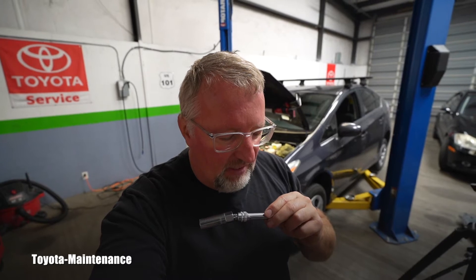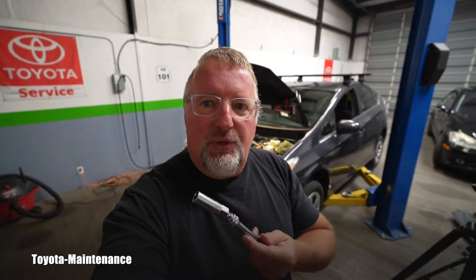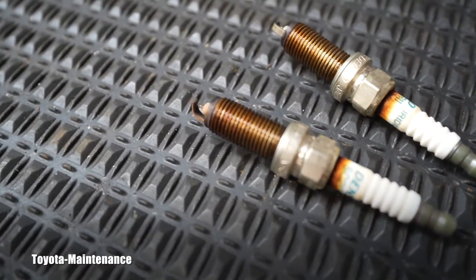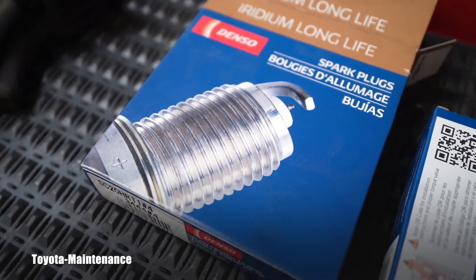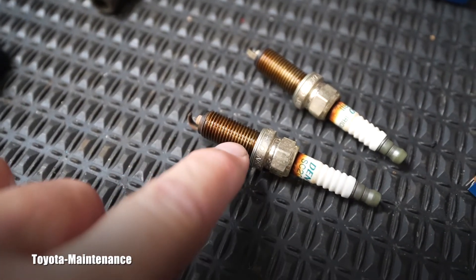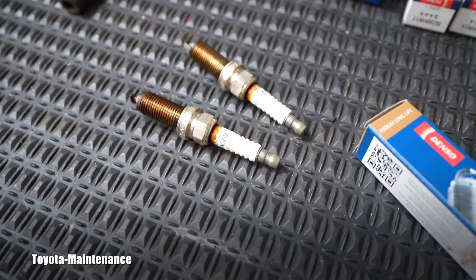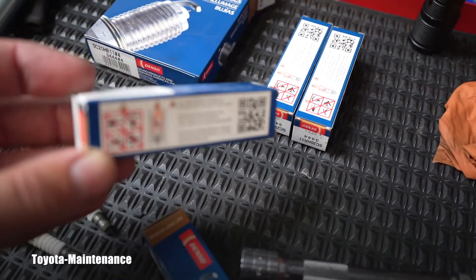To remove these, you probably noticed how thin they are — they are not the old-style spark plugs. These are the pencil type, and you need a 14-millimeter socket. Now, what will happen if you overtighten them? If you yank too much, these threads are being screwed into an aluminum head, and that thread could actually strip that aluminum head, resulting in a very costly repair. So you have to be very careful not to torque them too much.